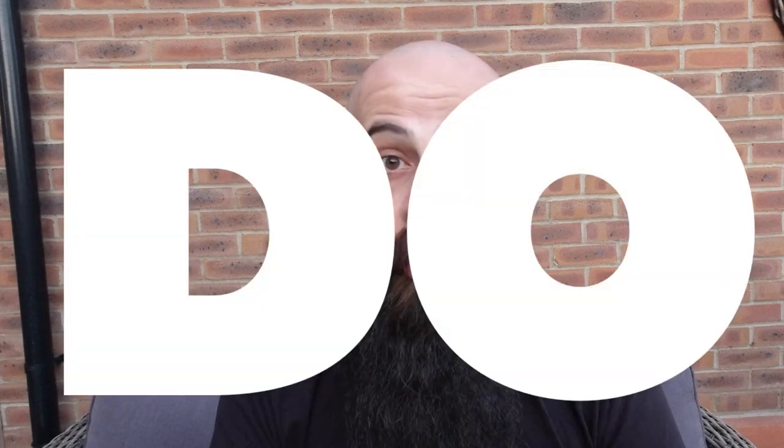So you know and can guarantee that these wheels are going to be strong and fit for purpose. Do measure the size of your wheels and also the fitment. Now, fitment is made up of a certain number of things. You have the pitch circle diameter, or PCD, which is the measurement around those lug holes on a wheel.